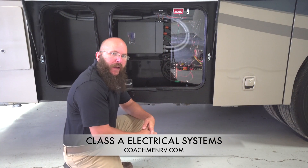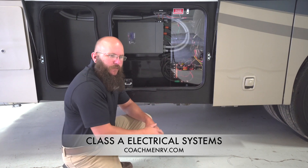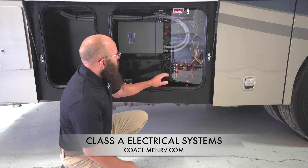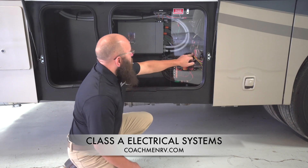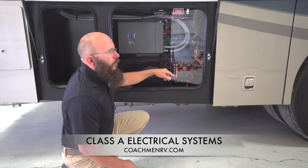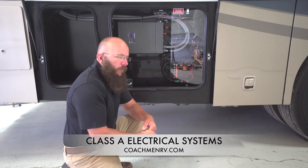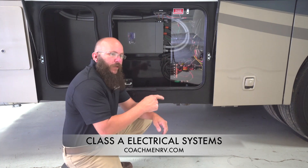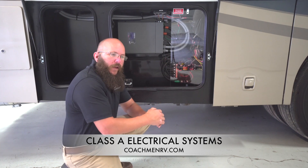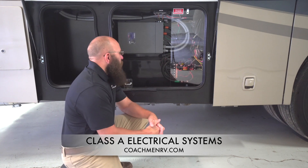On the other side of the motorhome — back passenger corner — regardless of the diesel you have, the layout is the same. The location of the electrical components we're working with today are pretty much all the same. Inside here you can see a lot going on: relays on the sides, slide controllers up top, and your inverter/converter. This takes care of all your charging for the motorhome. For example, if you've got a refrigerator on board, as you're driving down the road you can turn your inverter on. The motorhome will continue to charge itself via the alternator back into your battery bank, and it'll invert the 12-volt power into usable power for the refrigerator — nice, convenient, no hassle.